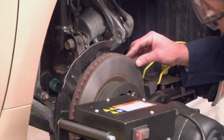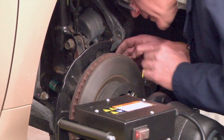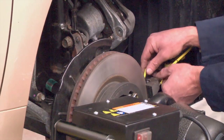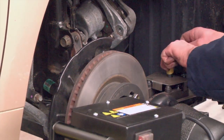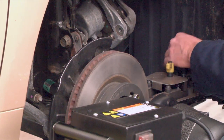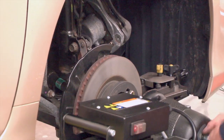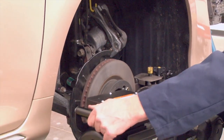Once you've completed the cut, you'll want to look carefully at both sides. Use a flashlight so you can see the rotor easily. If you've got a good finish cut all the way through, we're going to remove the silencer, loosen the lock lever, back the cutter bits out away from the rotor, and then remove the drawbar and pull the lathe away.